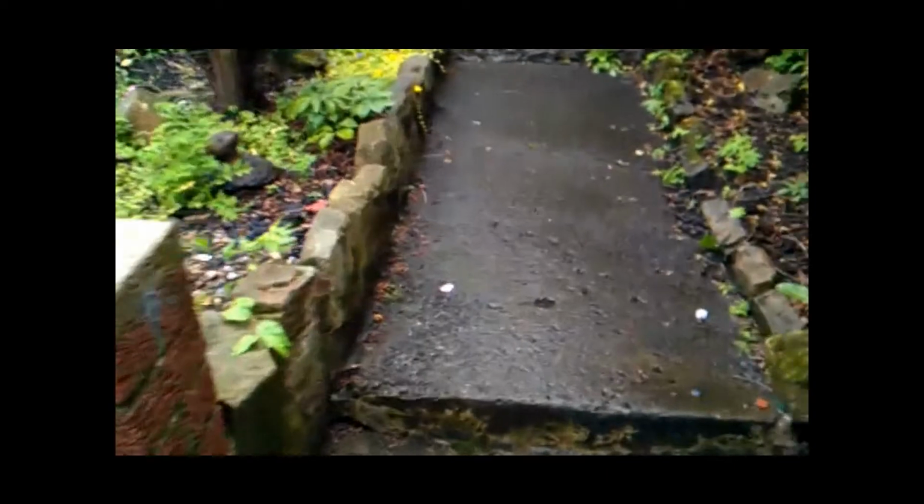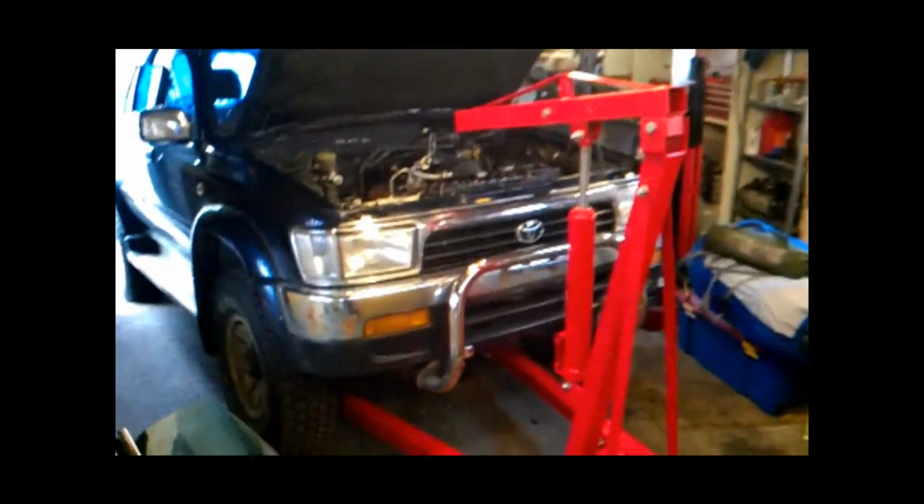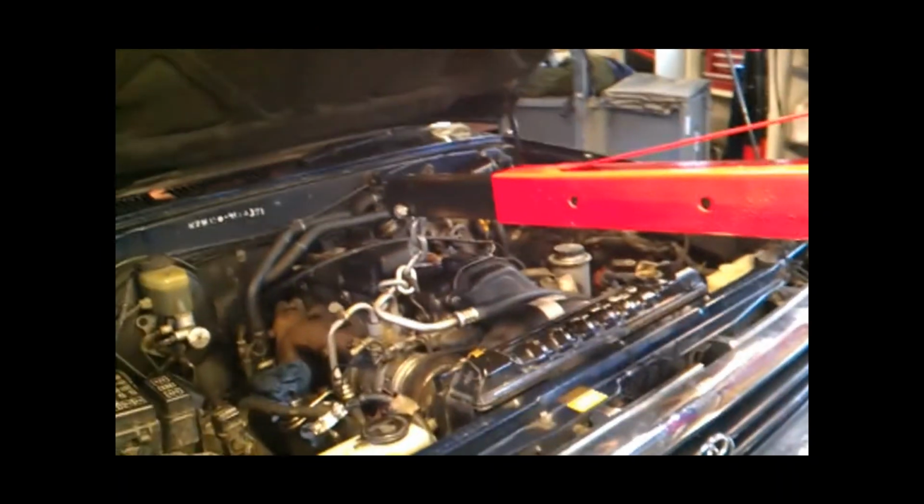Right, today's plan. We're going to undo 6 bolts, 3 down in the bowels of the engine, holding the engine mount on this side, and 3 on the other side. And then we're going to fit these new engine mounts. So, the plan is to undo 6 bolts, support the engine,